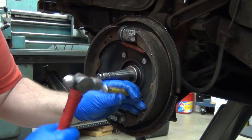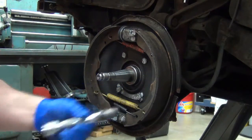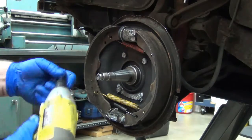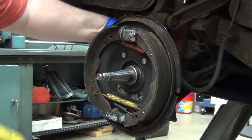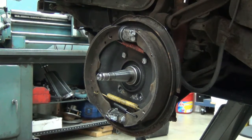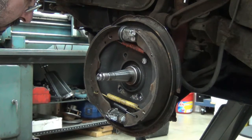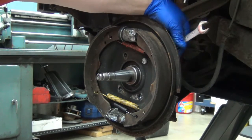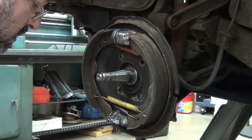There are these locking plates down here — only one side's down there. I think they're 14s — no, they're 9/16s, which is pretty close to 14. Let's use the 9/16s. These two bottom ones thread into the spindle. The top ones have nylocks on, so let's grab a wrench for that. We won't need any of these nuts and bolts because new ones come in the kit.